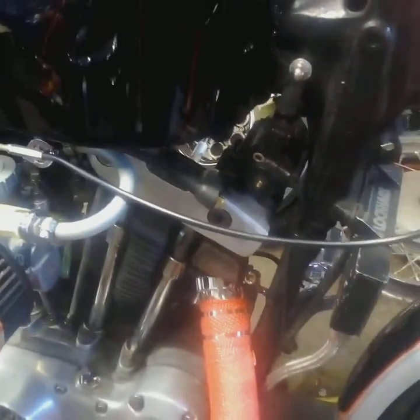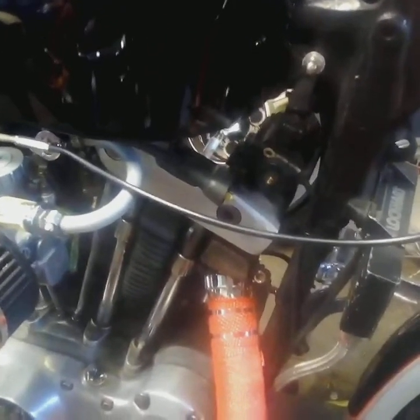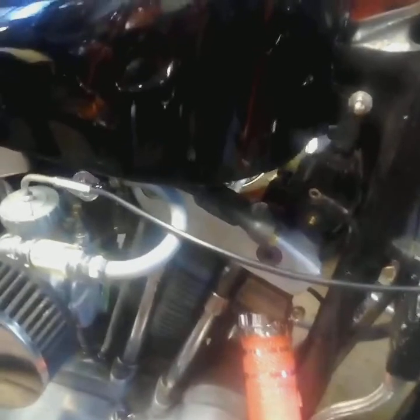So then you go to where the spark plugs plug into it, and you can see I've got it unplugged. You take your 12 volt tester set on ohms. Now you want to set it for 20K, which is 20,000 ohms. And then test your two leads, put one in each spark plug hole, and you should read anywhere from, I believe it's 16 to 20,000 ohms. Double check in your manual just to make sure I've got the range right. But if that doesn't test where it should, then you've got a bad coil. And guess what? We don't have the right ohms coming through that.